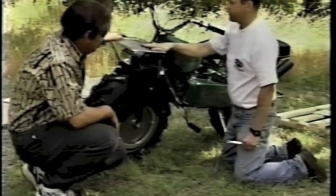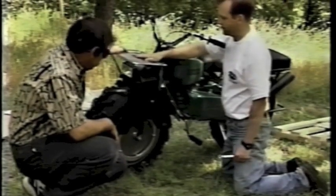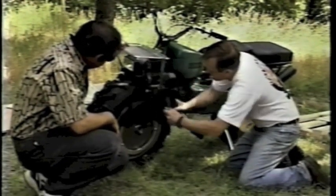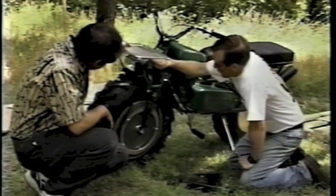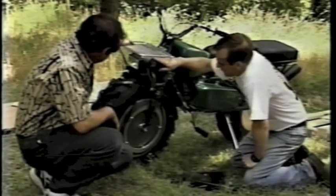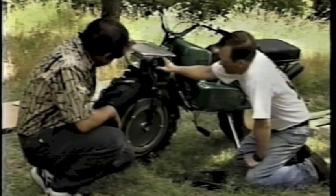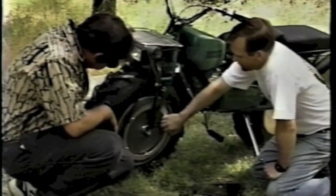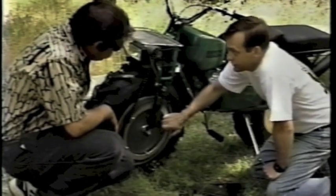The power goes into this miter box, as we call it, that sits above the front wheel. If I take this off, I can show you that inside the box the bevel gears are driving an 11-tooth sprocket, which in turn pushes the chain driving the 84-tooth sprocket — and that, in essence, is two-wheel drive.